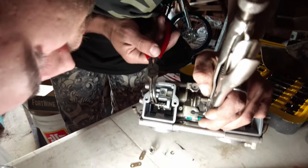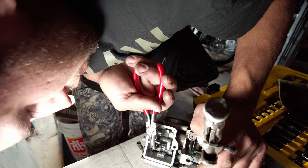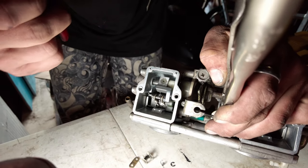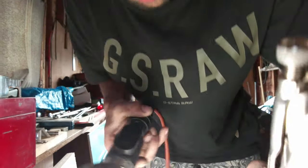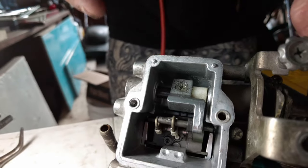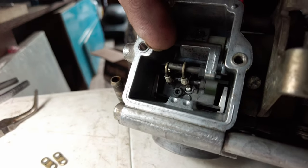I'm sure they make tools for this. It's very difficult — this stuff's like, pull it just in the right way. Do you have straight needle nose pliers? They're not grabbing at all. So we look in here — those two go right around both of those pins. That holds the throttle plate in, and they slide into here to keep them a certain distance apart. This spring wraps down around both of those two pins.